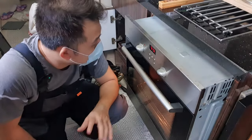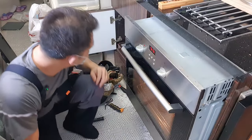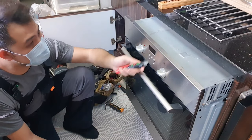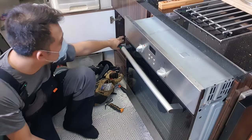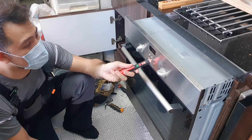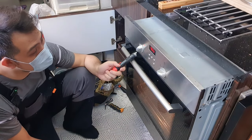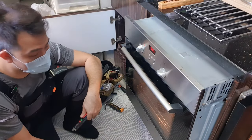The first 15 minutes are up and it is still running. I am going to switch it off now so I can manipulate the controls — you switch it off at the wall. You use your test pen just to make sure there is no more current running through it. Now you set it to 150. Once it is at 150, you switch it on at the wall again. You can see it is live, then use your test pen to press and activate the oven. We are going to keep that for another 15 minutes at 150, then 200, and I will come back once it is at max power.